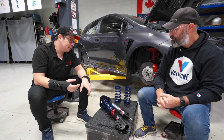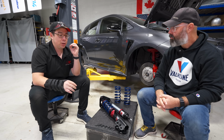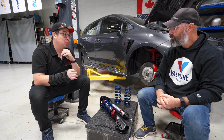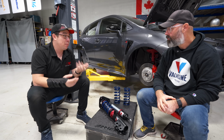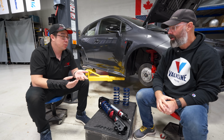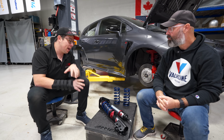So if you've got a shaft that is just quickly turned out, it's not polished, and you've got seals that are kind of quickly made and they're just kind of rough, you're going to have issues with oil staying in the shock because you don't have these great surfaces, right? And as you can imagine, if you guys ever polish something, it takes ages to make something super smooth, right? So there's a lot of expense that goes into that part. So that's kind of like the mechanical side of it.